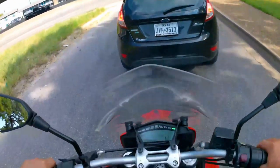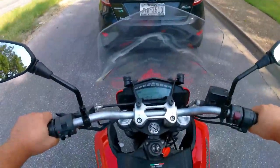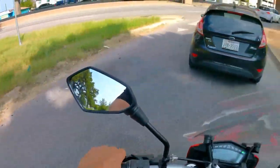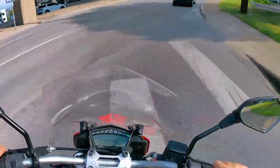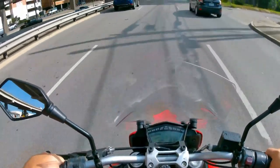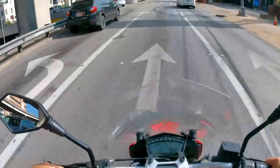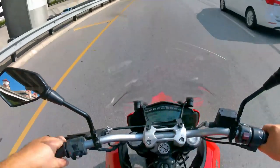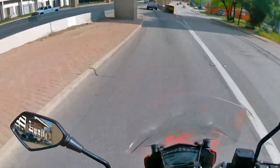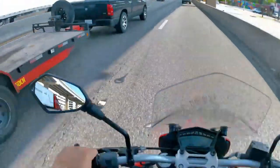Touring mode has a DTC value of 4 and an ABS value of 2 from the factory — that's what I'd call normal. You'd ride in the city or on the highway most of the time. There's enough protection you're probably not going to hurt yourself badly, but there's enough slip too. It officially sits in medium power but you actually get all the power; the delivery is just a little more subdued — not quite the same insane throttle response as Sport mode. Touring is where you want to be nine times out of ten.